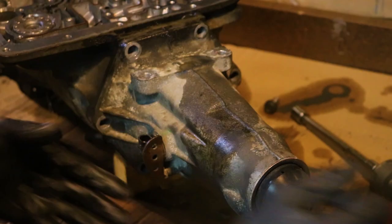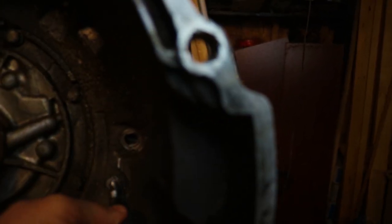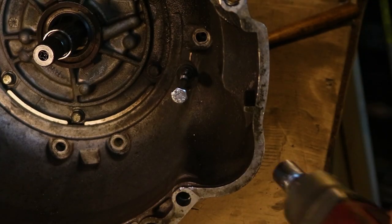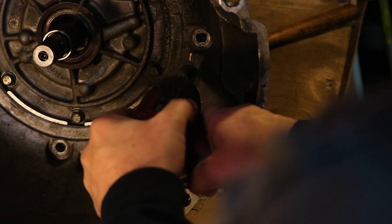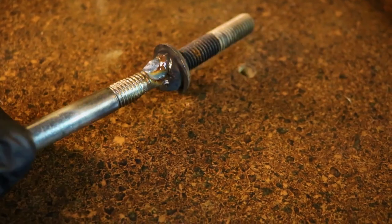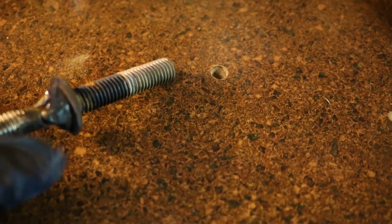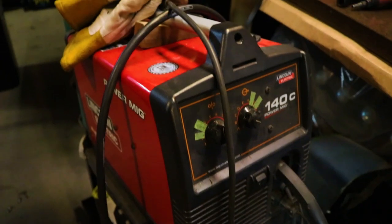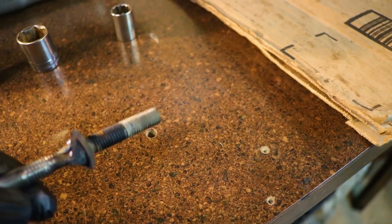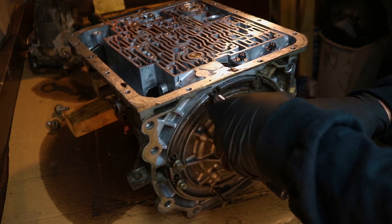It's the next day. I got some grade 8 bolts, so hopefully I can weld this guy in there and get that freaking bolt out. Here's my contraption: I bought a grade 8 bolt, ground it down, stuck it in the hole, and welded it as best I could with a Lincoln 140 MIG. I also heated up the aluminum and hit it with a hammer a couple of times just to loosen things up — and it worked. Now we can move on to the next step.